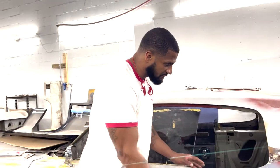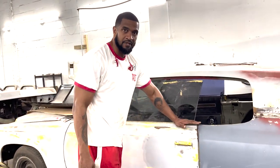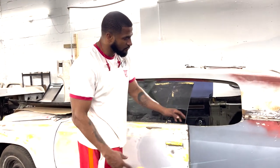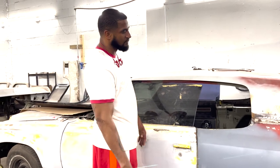Then we try to cut and fit, because these quarters go on based off the alignment of the other parts. So if the door and the fender are not right, when you do weld this on based off a door that's not in the right place, when you try to line everything up, it ain't gonna line up. So